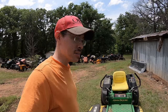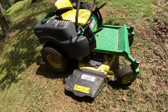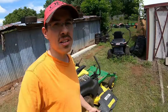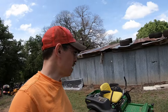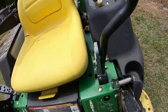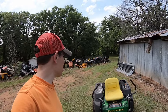I think that was a resounding success. This thing is running and cutting pretty good. I'd say the engine is running about 85-90% — maybe still a little lean, but it's got good power. The deck, I'm not super keen on the scalping ability, though it leaves a decent cut. With a fresh set of blades it would probably cut much better — right now it's probably at about 70% of what it could do. I'd also like to get the steering bushings replaced, because there's a lot of slop in the steering bars at multiple levels. But we got the job done — the yard is mowed and this thing is now usable.